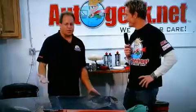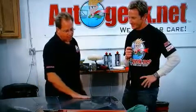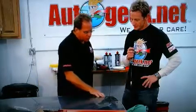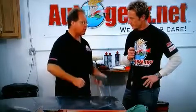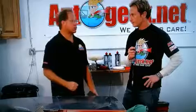That's right. And the problem is you can kind of sand a smooth flat area, but as soon as you get around some of the corners, by the time you sand it, compound it, and now you're polishing it, the chances are you could go through. And if you go through, you're going to have that section repainted. And my wife will not be happy. I promise you that's her vehicle.